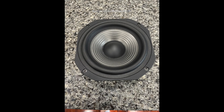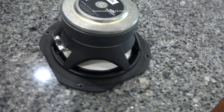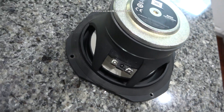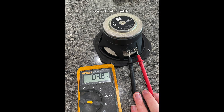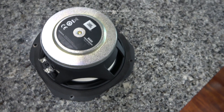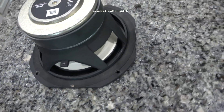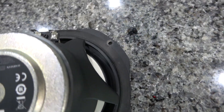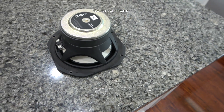The mid-range driver out of the Studio 630 is pretty decent for this speaker's $700 price point. JBL is using a die-cast aluminum basket which offers several performance benefits over the typical stamped steel baskets I normally see in this price range. Die-cast aluminum is more rigid and will offer less ringing over a stamped steel basket. Die-cast baskets also have cooling benefits — they will offer better heat dissipation, which in turn helps keep the voice coil cool, allowing the listener to crank it up for those long and loud listening sessions.